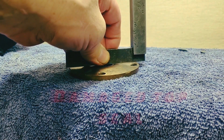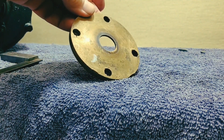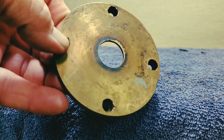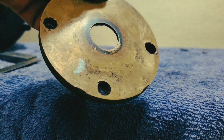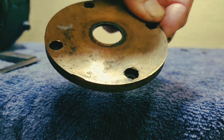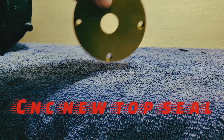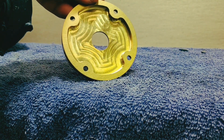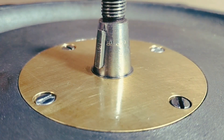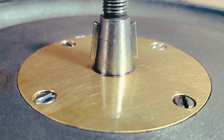Here you see the top plate or top seal. You'll notice with that straight edge I just showed you, it's massively warped. That comes from people beating on the end of the supercharger shaft at the bottom, thinking that's how you get it out. No — you remove the rotor first, take the screws out, take this out, then take the shaft out. Unfortunately, people don't know that. There's the brand new CNC top seal that we make, with one-thousandth accuracy. In a moment we're going to show you how beautifully it turns — and there you see one-thousandth accuracy as you can turn the vertical shaft beautifully.